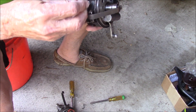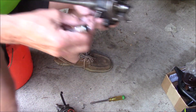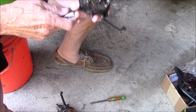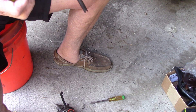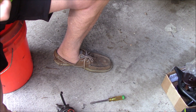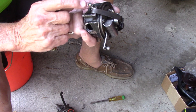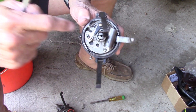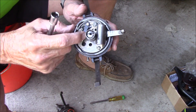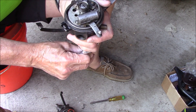Get a nut that fits it, and another nut, put that in a driver and tighten it down. Now I have an ohmmeter here — you may not be able to see it — but this does not communicate with ground. It communicates with the lower plate, which communicates with the movable point arm.